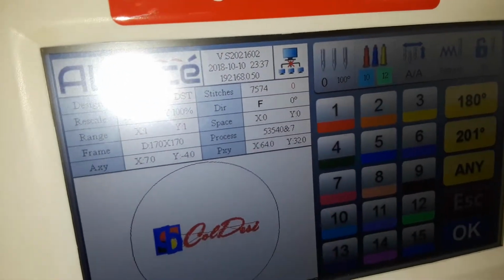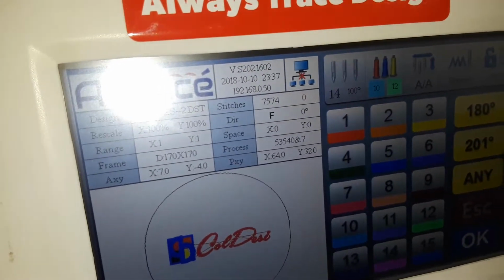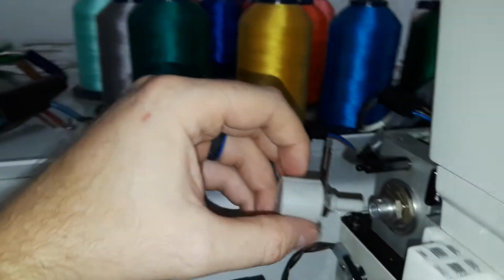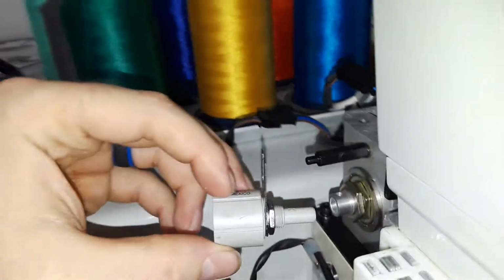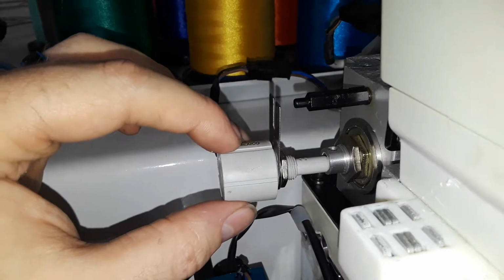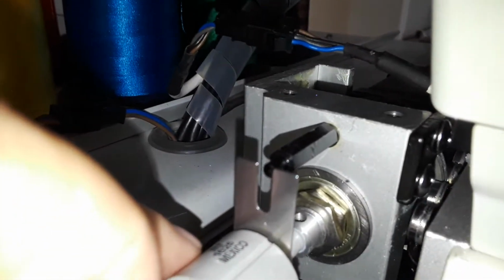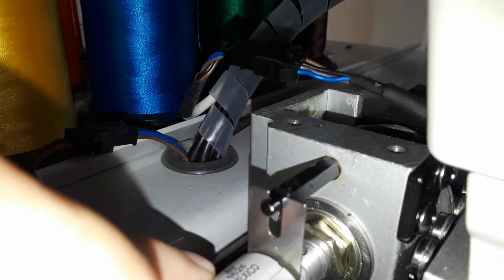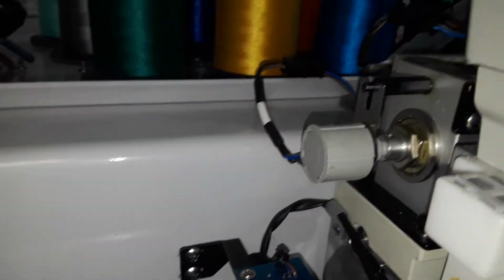And if you ever feel any resistance on the sensor, just stop and go the other way. These sensors do have a limit, and if you go over that limit, it will break the sensor. So we very carefully have it in the number 14 position. And we're going to, to the best of our ability, insert it into the machine as straight as possible, lining up the groove on that plate with the groove with the post that's coming off on the machine.